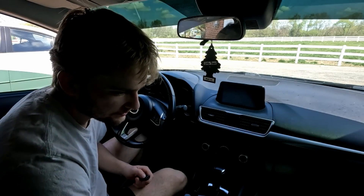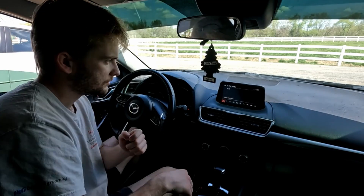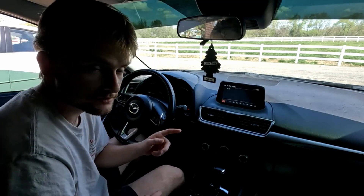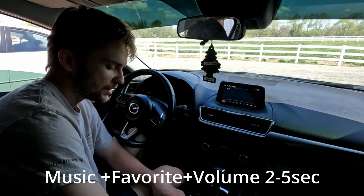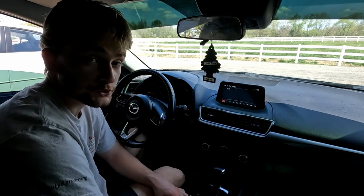The beginning steps of this process: first, do not press the brake pedal or the clutch — just tap the button and go to FM radio. You're going to want to open up the test screen. The way you do that is by holding the music button, the favorite button, and the actual volume button for two to five seconds.